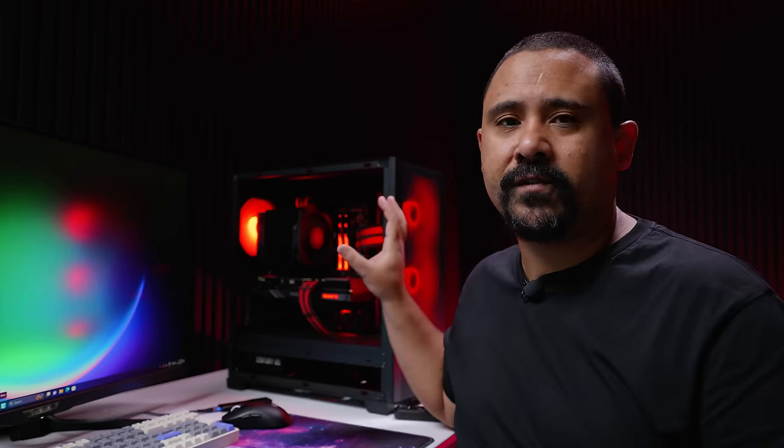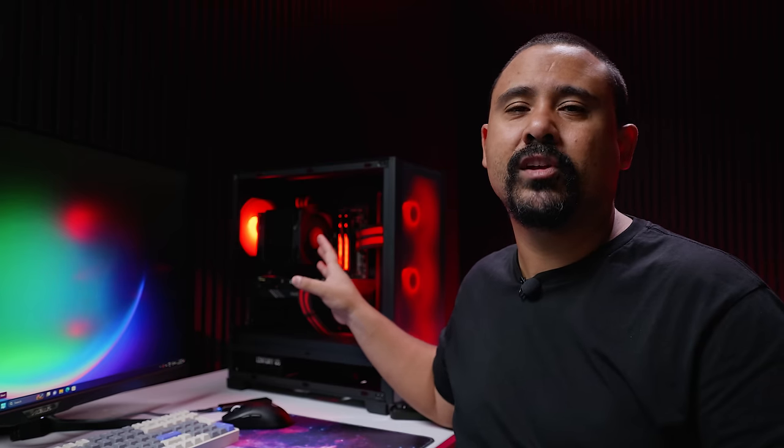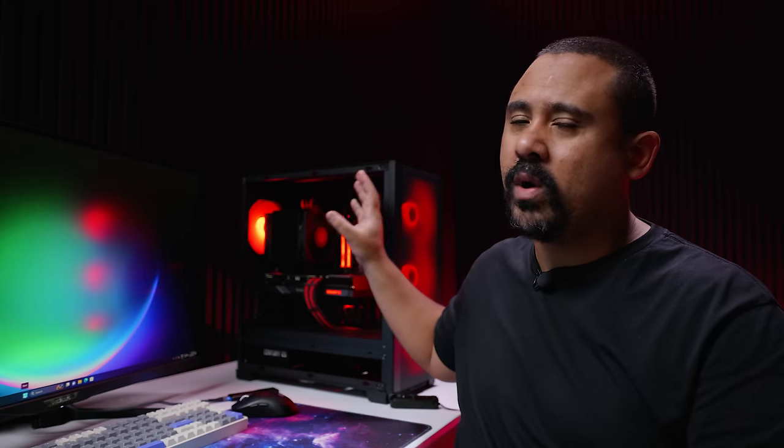When you do air-cooled builds like this one here, I would usually recommend not putting exhaust fans on the top of the case. It can impede airflow. Even for my own personal gaming PC, which follows the airflow path of this, has really good thermals, and I've got much higher end hardware. So I would say if you wanted top fans for aesthetic purposes, you know, do that if you like. It will impede the airflow a tiny bit.